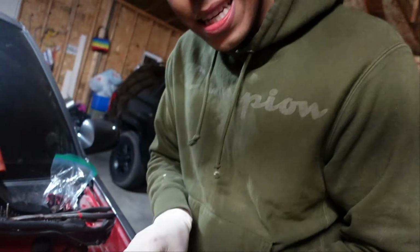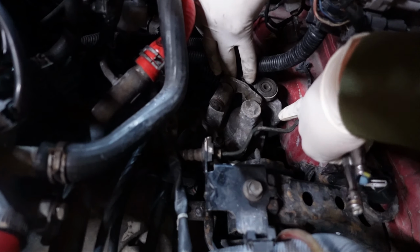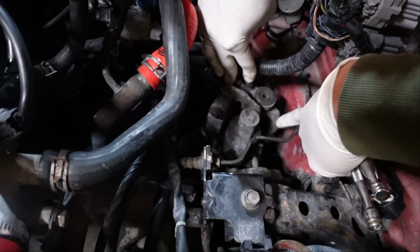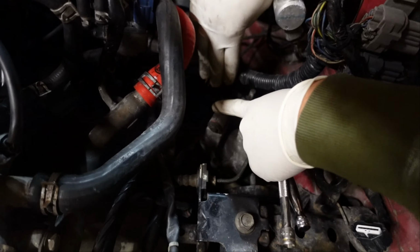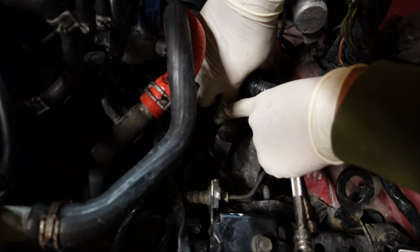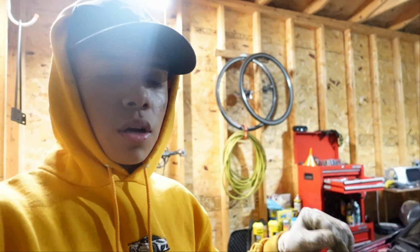So in this case, you're asking, David, where are the bolts located? Good question. All right, so now as you guys can see, we have one right there, another one, number 2, and it's a little dark, but the third one is lying right there. Those bolts connect the shifter to the transmission, and that's what we're gonna use to take it out.